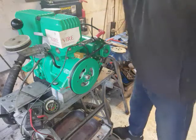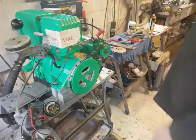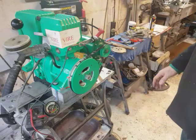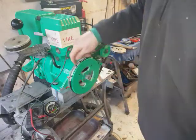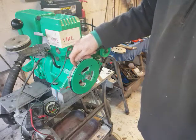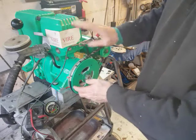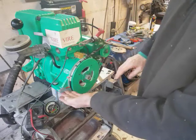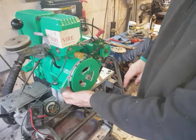You can see we've got a good spark here and the ignition points are opening and closing. The timing mark is a slight dent in the flywheel — I've painted it red to make it clearer. On a 7 horsepower engine it will line up exactly at the bottom of this buttress, which is the firing point.